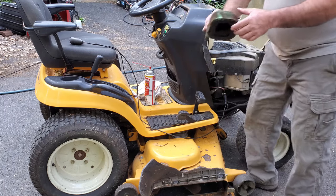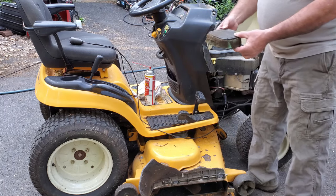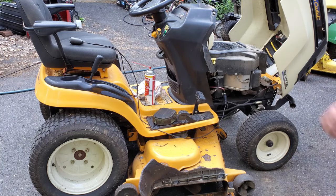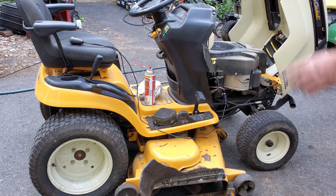This is a trick for how you can go about making an engine run — there I'm showing the very dirty air filter. This is how you can make an engine run regardless of what condition the carburetor is in. You're going to have to clean it later, but you just want to know if an engine will actually start. Get battery power up to the starter — if you have a jumper box, hook it right on the starter. If you don't have a key, or if some of the safeties aren't working right, unplug the connections that connect the engine to the tractor and it'll run like that because the safeties won't cut out the ignition.